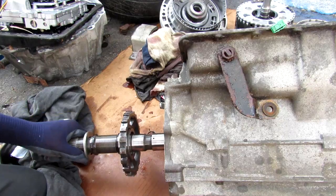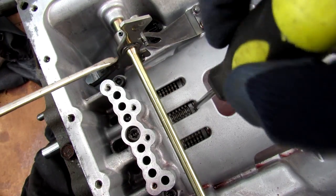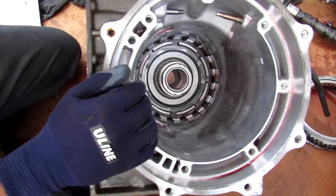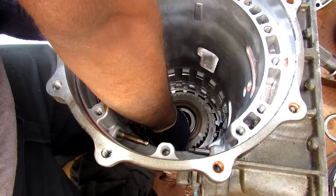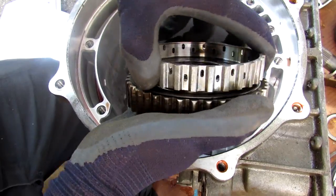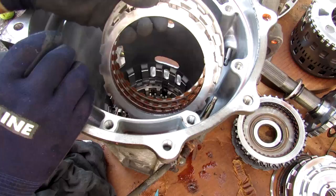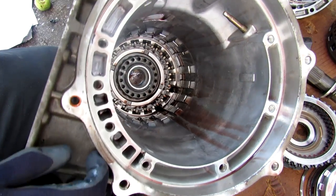I'm going to start by unbolting the tail housing and remove it from the output shaft — and then of course we have this output shaft, which runs the rest of the length of the transmission. The next set of clutches inside is held in by this snap ring — it's the reverse brake. Now the last set of clutches in there is for the reverse brake clutch. I'm going to remove the back part of that reverse brake piston. The last part we have is a one-way clutch — you can see that this rotates freely in one direction, and in the other direction it's nice and firm. And finally in here we have the forward brake set of clutches — oh, these look pretty bad.